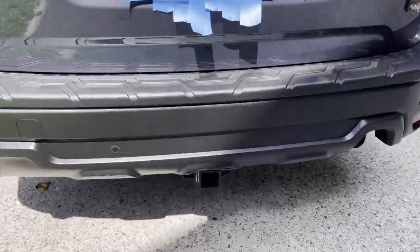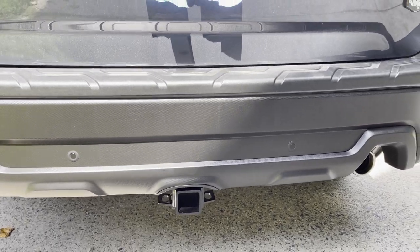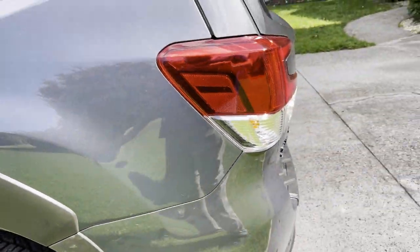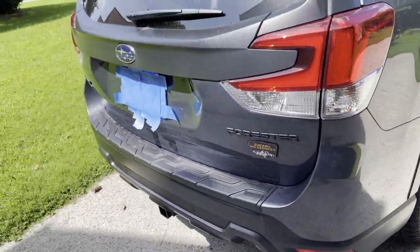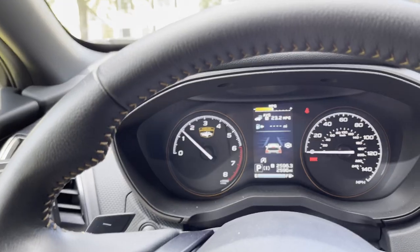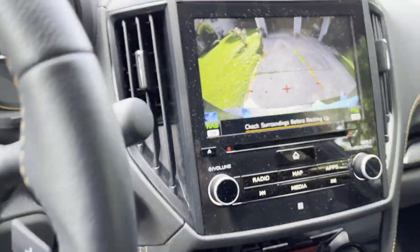Some final thoughts - there's the install, it looks pretty good. I think the cut is fairly even, and that was one of the hard parts. The hangers were the other hard part on the muffler. It did take most of the afternoon for me. The shop was going to charge about 400 bucks for a two-hour install. Looks like everything is working correctly. No check engine lights. Threw it in reverse and got everything working.